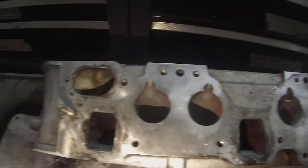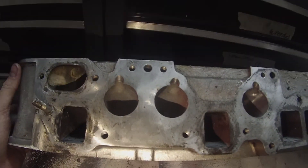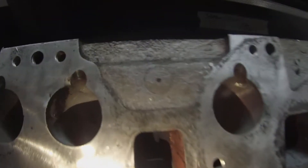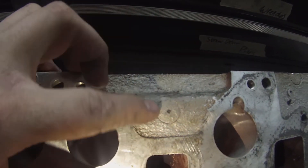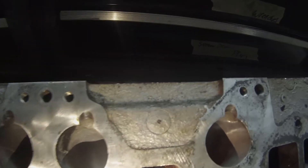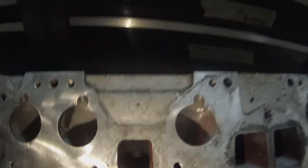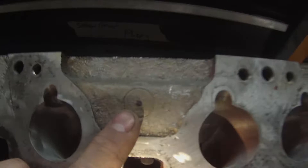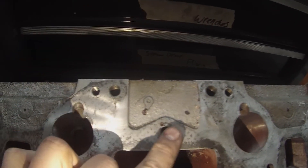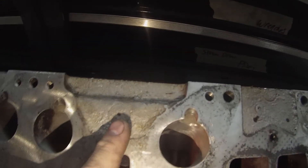Over here we have a P90 cylinder head. In this head there's a boss embossed or stamped into the casting of the cylinder head right where you need to drill the ports. You need to drill right above each exhaust port. There's a coolant galley — one right here, one right here, two right here because there's two ports, one here, and then obviously you have your thermostat right here.